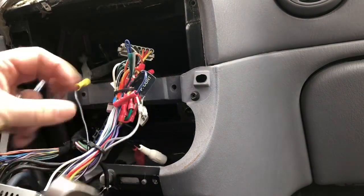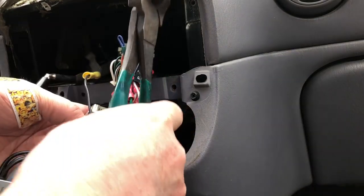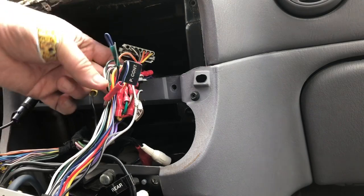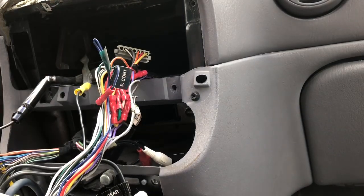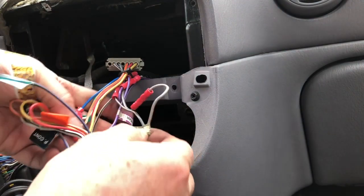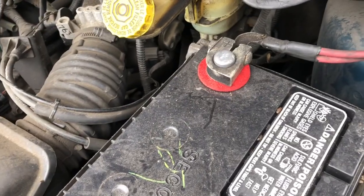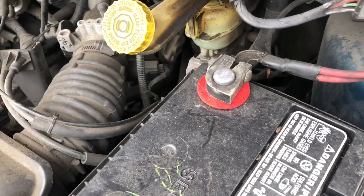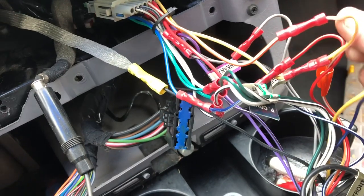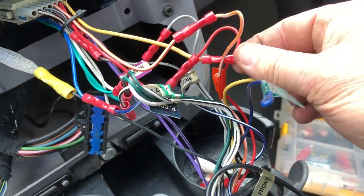It's pretty cool how they took a couple of zip ties — like a professional did this, except this is not a professional. I'm going to clip those zip ties and release the wires. You have your front right, your rear right. I think you may want to disconnect your battery cable — I'm not going to, but it's helpful. The reason why is this yellow wire is usually live. There's a way to clip it and keep your battery connected where you know you're not risking an arc or blowing a fuse.